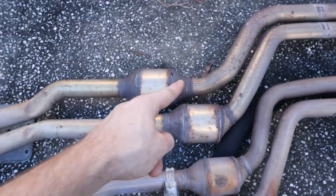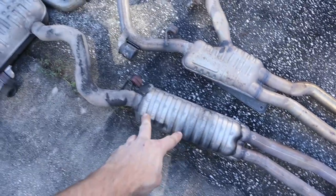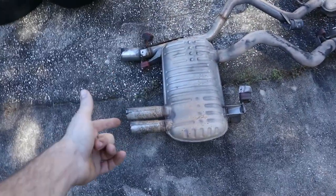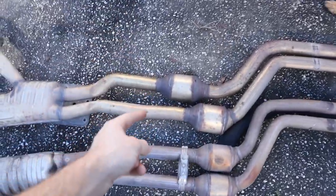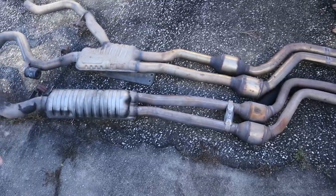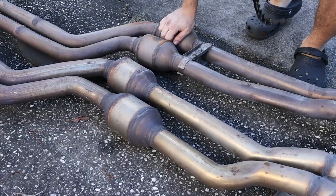combined exhaust system. So from the 335, we're gonna go to the 325 system, gonna use the factory resonator and the factory rear muffler, factory tips. So it's going to be really, really quiet, hopefully, and look like the factory exhaust system, but it's going to give us that sleeper aspect to this build. So what I think we're going to do is start cutting off the two exhaust systems, and then we'll go into the garage and start test fitting our system, and then we'll start tacking it up and get into the welding.